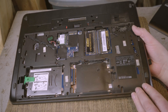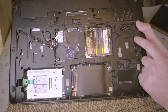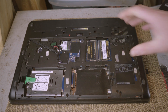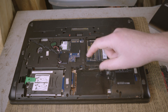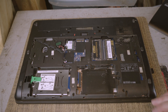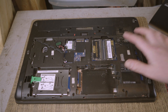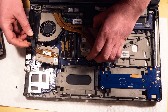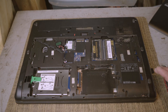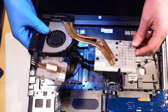There is one screw that attaches to the entire fan and GPU assembly. When you put it back in make sure it's secure because it pulls in the entire assembly. It's the only one that attaches to both the GPU and CPU — the whole big chunk. The heat sink is attached by eight screws, four for each one. Undo those. When pulling out the heat sink, lightly lift it and push it from the bottom, sliding the entire heat sink assembly up — it requires a little shaking to get out the first time but comes back in easily at an angle. Just take care of the internal parts.